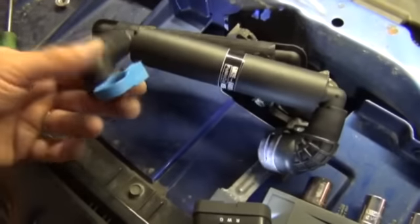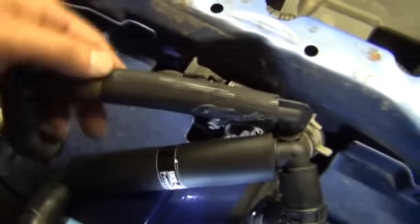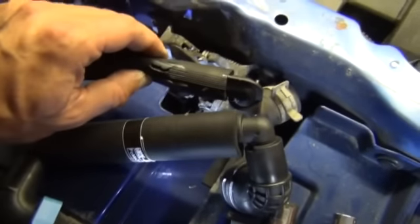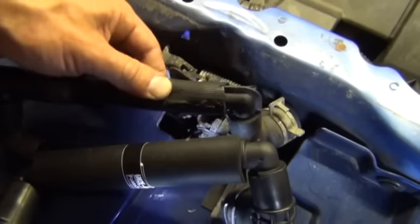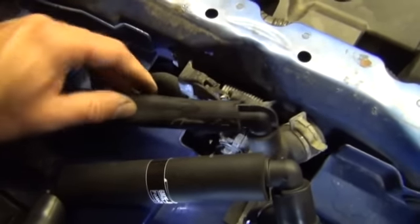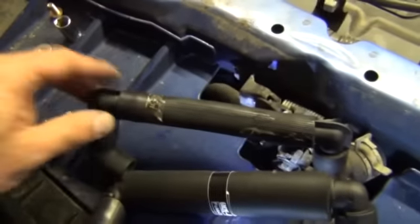It has this nice little piece on it — just pop that off and it automatically spring-retains down. What fails typically — as I saw on another YouTube video which helped me diagnose my wife's car — is an air leak in this hose itself. When I sealed it with a little bit of RTV, it actually just sucked the hose flat, and you could hear it squeak or make a high-pitched noise as the pressure released when you shut the engine off.